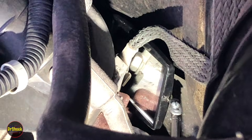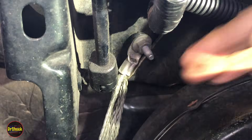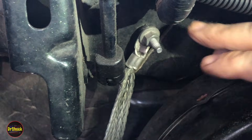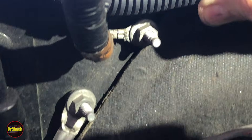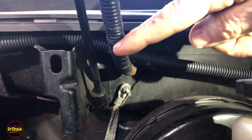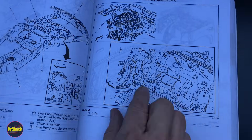Back on the driver's side near the brake master cylinder and booster, a ground strap runs to the back of the left cylinder head. Using the inspection mirror, G104 is visible where that ground strap attaches at the rear. Following the strap up, where it attaches at the top is G108. Just above G108, moving the harness aside, is G110. Tracking the harness up to the hood is G111.